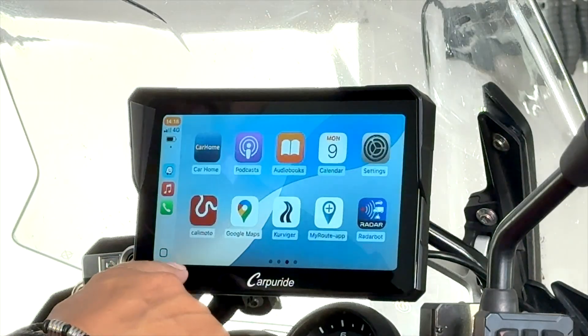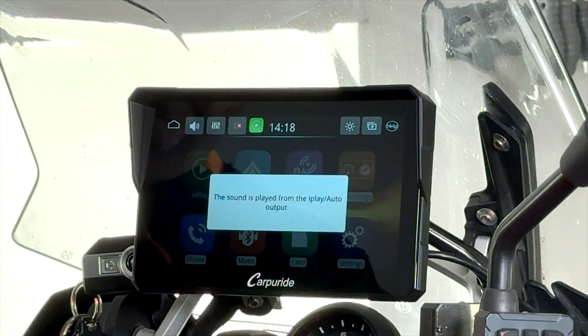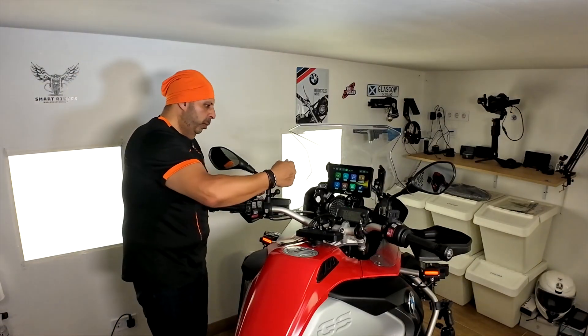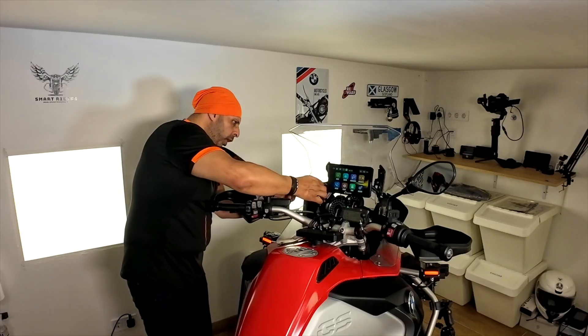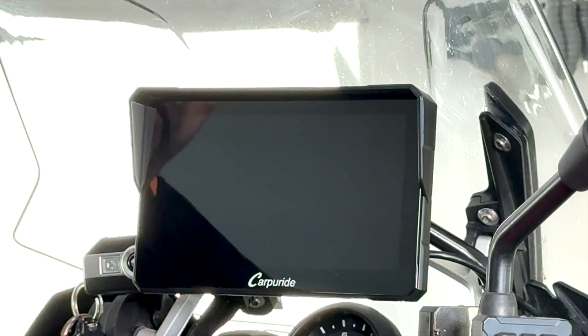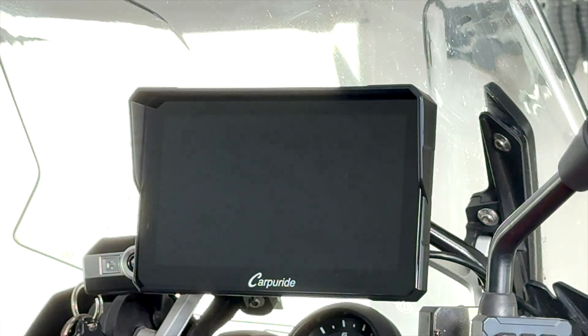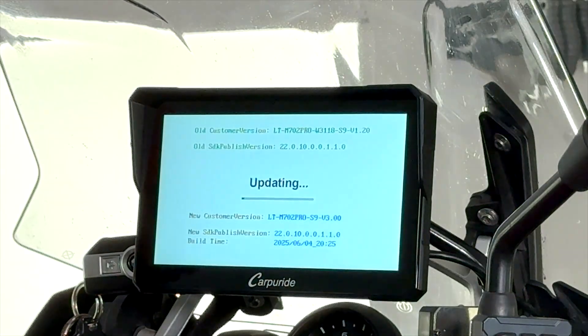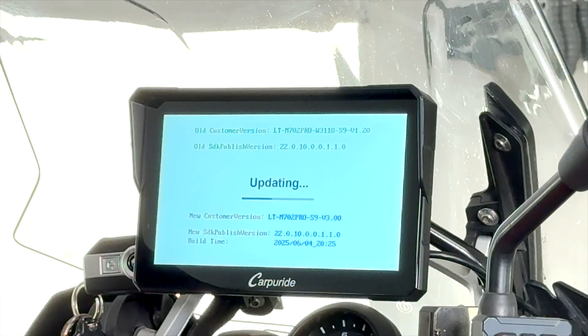Okay, so let's find the car home screen. We're on this screen — the unit has been on for more than 10 seconds now. So now I'm going to put the card in all the way. We're going to tick yes to confirm. So we now just wait and let it update. As soon as it's updated we will switch the machine off, take the micro SD card out, and then boot the unit back up again.